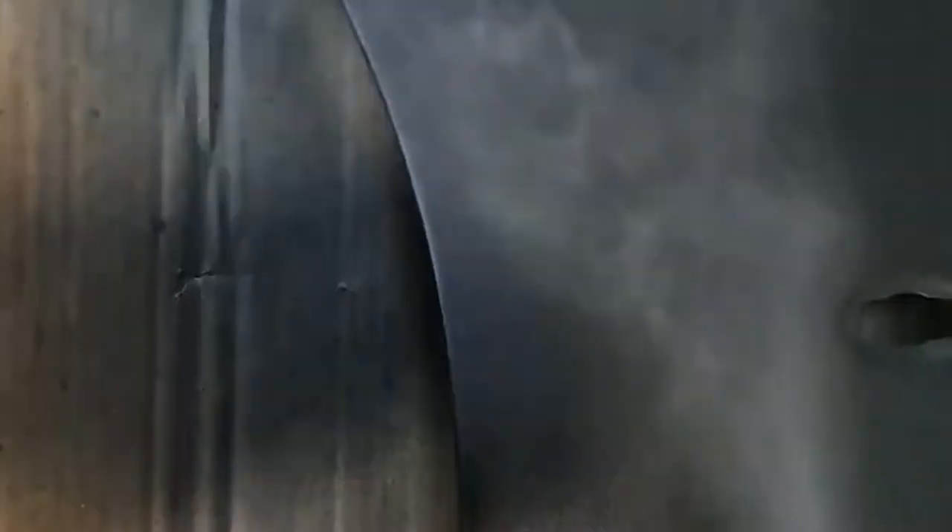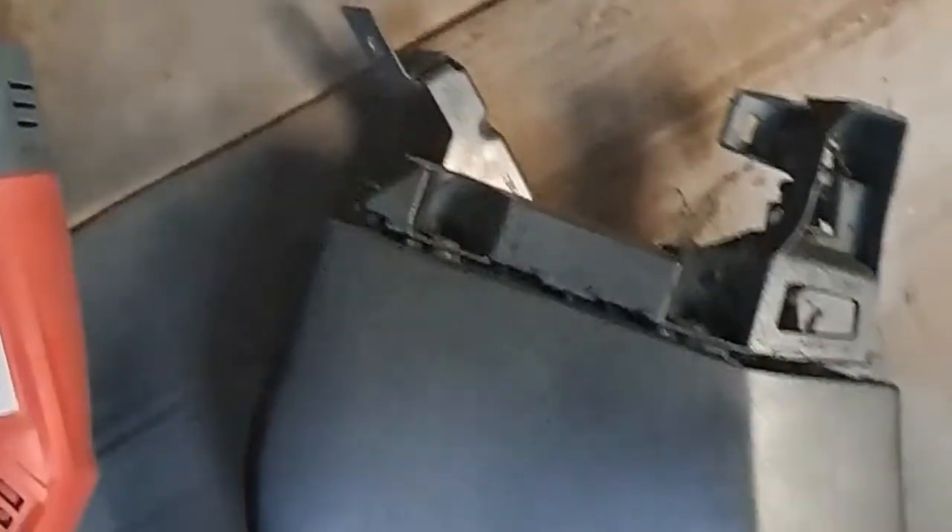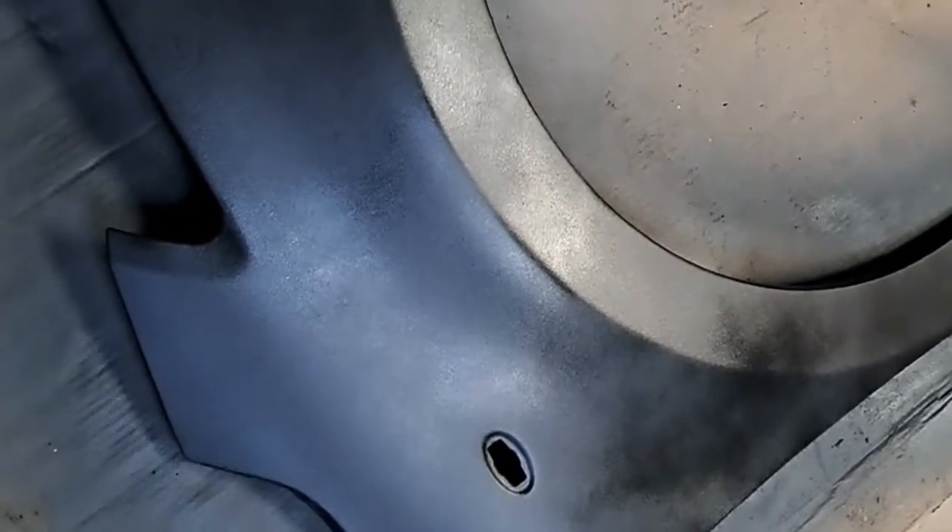Just about to apply the second coat — this one can go on a bit thicker and more thorough. Try and hold it about 15 to 20 centimeters away from the panel. Really, the panel should be upright because you get a better spray action from the can, especially if it's only half full — but this is a full can. Give it a quick light dusting afterwards and go around the edges as well, then go over it with the heat gun.